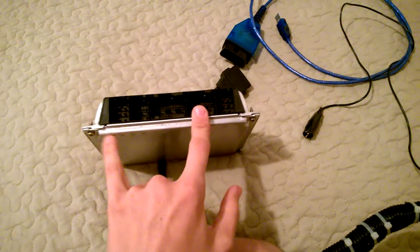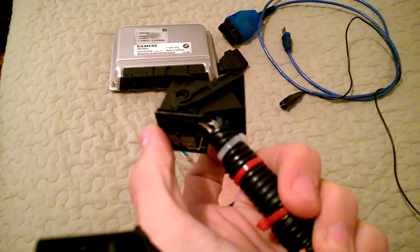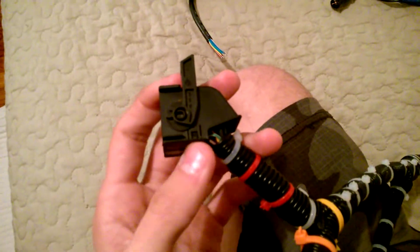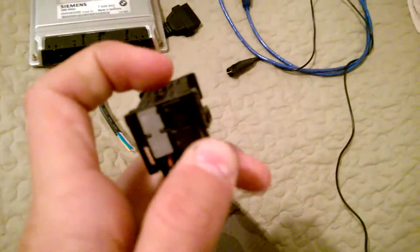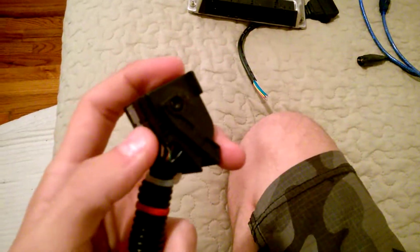You need this plug and this plug — I think they're the same ones. I chopped them off my engine harness and it works. Now you have to figure out which pins correspond to which wire colors. It's hard to see the wire colors at an angle, but luckily this connector block can be easily taken apart. You just lift it up and the black side will slide out. You basically only need the black side.